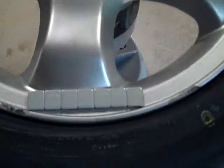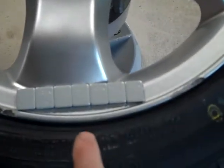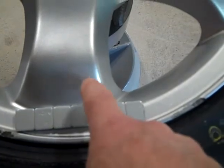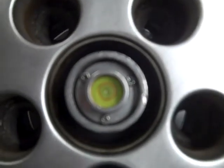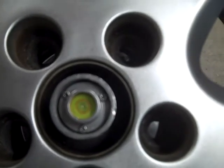I'm happy with one and three-quarter ounces right here. I've got a yellow marker to mark this spot, then I'll clean the area on the inner wheel and lay the weights right there. Now I'll put it back on the machine and double-check it — I'll call that good. There's tire number three done.